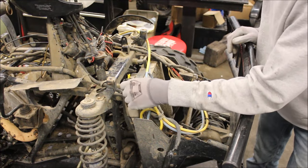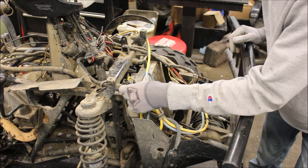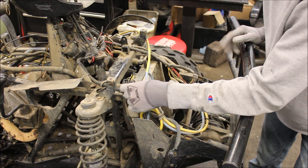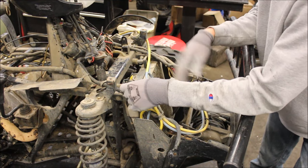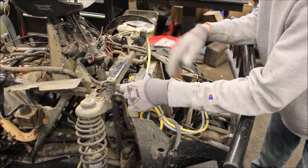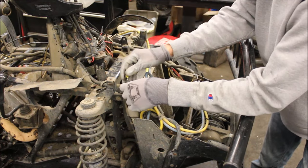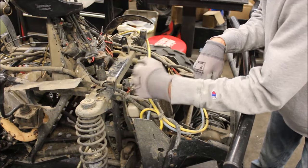A lot of guys wonder how to hotwire their fans — this is a quick way to do it. On these older models, I don't rely on the temperature sensor on the radiator. The temperature sensor could be bad — you could just replace it, get an aftermarket temperature sensor. If it's my own personal one, I'll just leave this hotwired and tape it up. Start it up and the fan's running constantly — that way you know the fan is on.